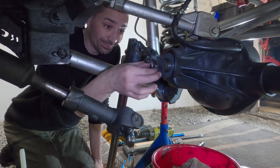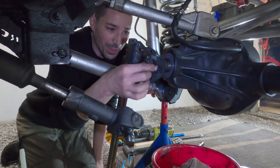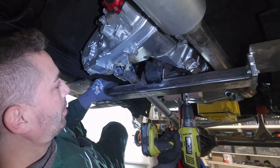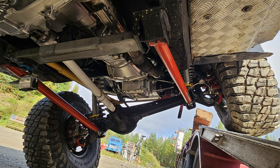There are some good affordable long arm kits out there that aren't much more than a short arm kit, and you're killing two birds with one stone - future-proofing it. I went short arms first, then drop brackets, which made it a whole lot better, and I ran drop brackets for nine years up until last year when I built this three-link. Now I've built the three-link I was like, I should have just done this ages ago. If you're buying suspension, don't bother with individual bushings on leaf springs because if you buy the right suspension kit you'll get all that stuff anyway. Just leave it and swap it all out when you do the full suspension job - no point doing it twice.